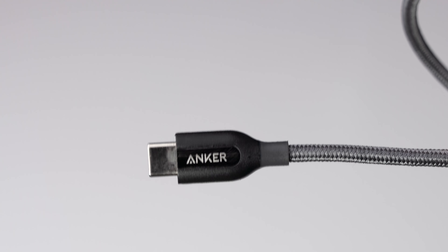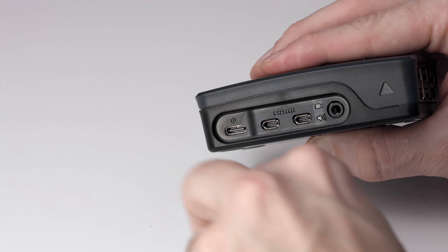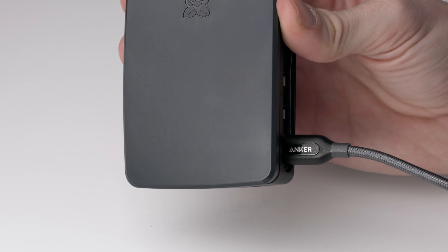If you're going to go heavy on storage, maybe even get 128GB or 256GB. The final thing you'll need is a good USB-C cable — and you have to be a little wary here. Not all USB-C cables will work when powering or connecting the Raspberry Pi to your iPad. The one I've had most success with is the Anker Powerline 2 cable. I'll put links to this in the description. It's ostensibly a power cable but it gives very good data rates for my use cases.